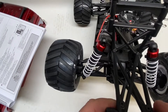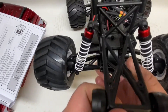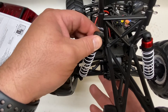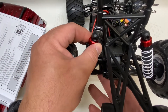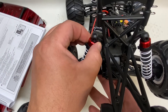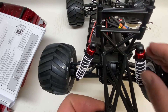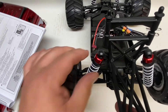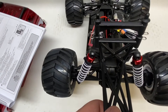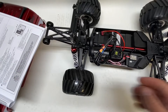I'm messing around with the shocks, tearing one apart and looking at the oils. I didn't change anything yet. One thing I noticed is this upper screw is really tight and it's sandwiching the whole shock solid to the shock tower. My suggestion is to take those top screws and back them off an eighth to a quarter of a turn just to give them a little wiggle room so they're not locked — because under massive flexing it could cause breakage. It's also going to cause binding right off the get-go. Just back them off an eighth of a turn so you barely get a little play and it frees them up quite a bit.